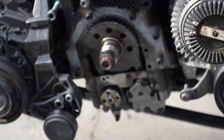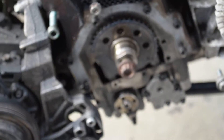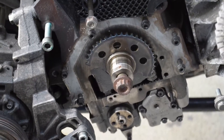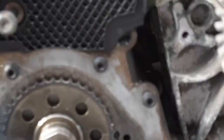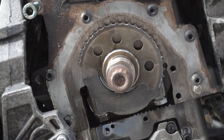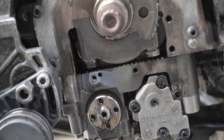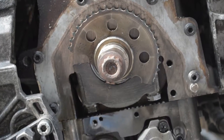This is a 2005 Volkswagen Passat B5 with the BHW engine — that's a TDI. I'm doing the balance shaft delete. I've got the front end off and the timing belt off. You can see the sprocket that drives the chain to the balancing module right below. When I attempted to pull the sprocket off, I shattered the sprocket.